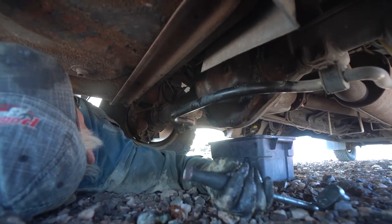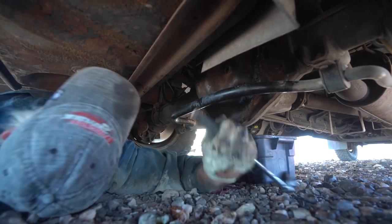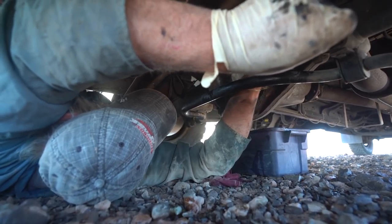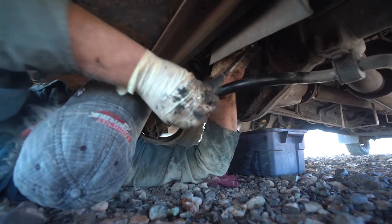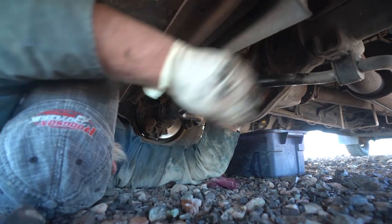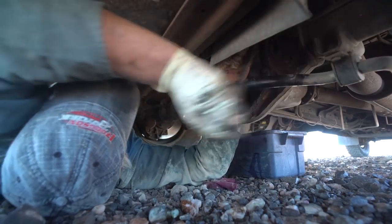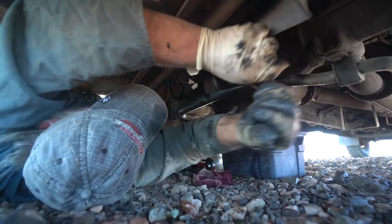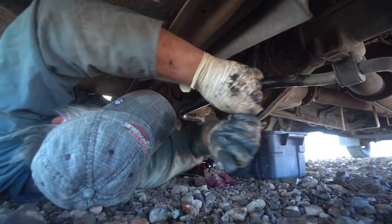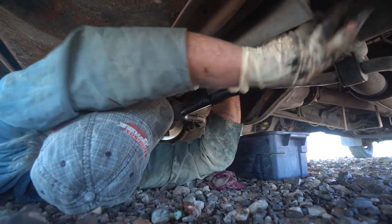The more they warm up, heat up, and cool off, you get moisture in it every time — because you've got a breather on them. Like even my Dodge — it's only a '12 — I only had it for a year or something. When I took the differential cover off, it was right milky. Wow. So yeah, it's not four-wheel drive — how did the moisture get in there? Probably because you were towing and it heats up. This was before I started towing with it, so that caught me off guard too.